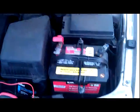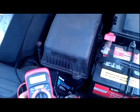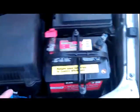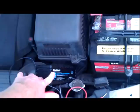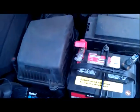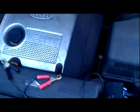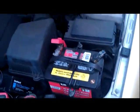Just to go through a good troubleshooting process, I have my Craftsman voltmeter. I'll go over how to use it and what to set it on in a second. Since it's not starting right now, I just have my little charger. I'm going to put it on a slow charge, come back in a few hours, try to turn it over, and then test it when the battery has a full charge. Then watch and see if the battery drops in voltage while it's off, and test to see if the alternator is putting out the voltage that it should.